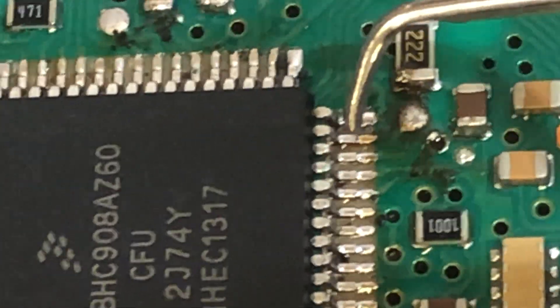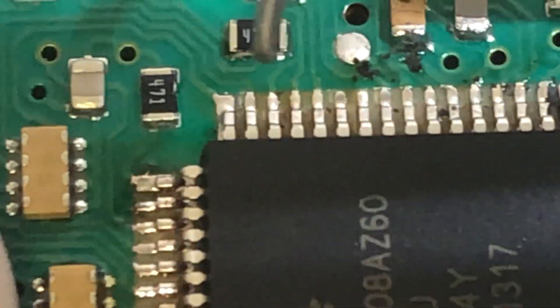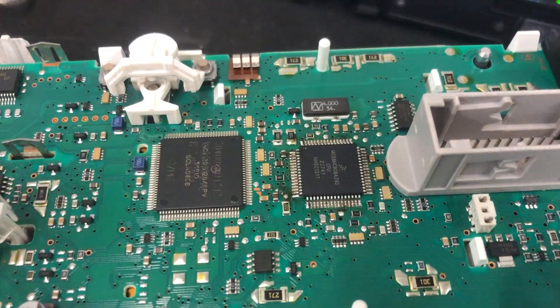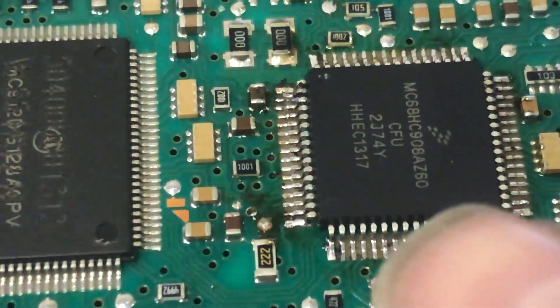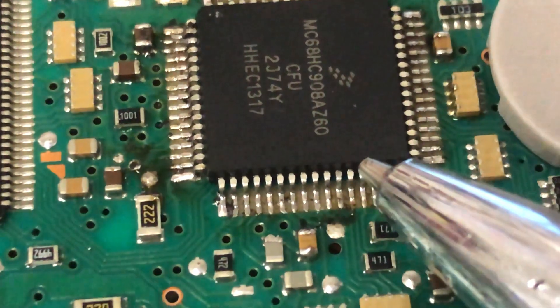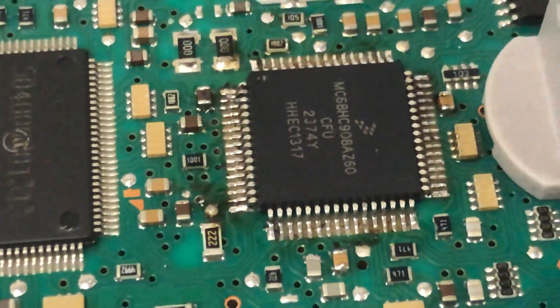With a very quick look, this one pin may not be attached — I'm going to zoom in with my jeweller's loupe to check. There are no solder bridges I can see. We're going to check all of these, then to program it I've actually got to lift a couple of these legs up. To give you some idea of scale: there's my fingernail, and this is just a ballpoint pen touching it — that's the size of the leg which has to be lifted very carefully. I'm now going to connect this up and show you how we program them.